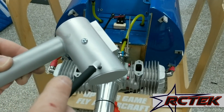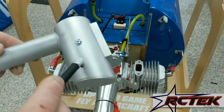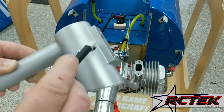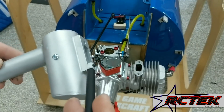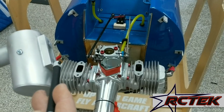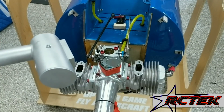I've got some brand new mufflers from DA — these are slimline mufflers. Much like several other brands of mufflers, they are either tumbled or sandblasted. These I believe are tumbled, and it gives them a nice satiny finish, but that also leaves a finish on the mating surface that we don't necessarily want. We want a nice smooth finish on here to mate up with the engine.